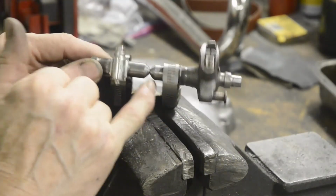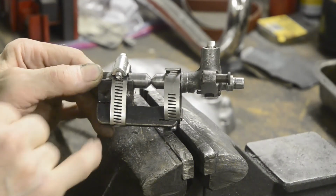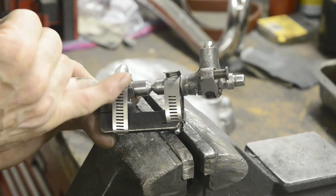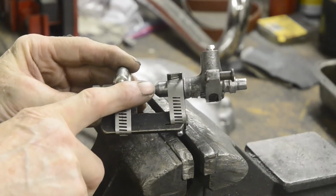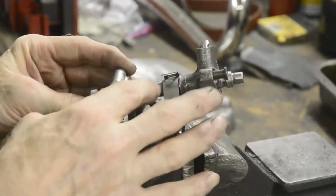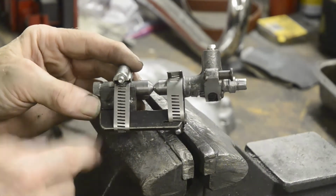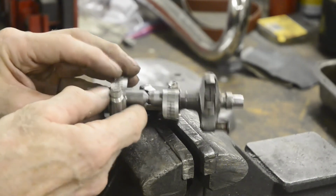Here it is with the two ends chamfered and fastened into the jig. You'll notice actually I didn't use the slot here because I remembered when I fastened it in that using the slot there tended to kick it up a little bit at the end, and they weren't exactly straight. So I put it right round the whole thing. There it's fine, it pulls it straight down into the shorter one, but here it was pulling it down. I couldn't understand why it didn't line up. And then I remembered that had happened, so I just moved the strap along. So now they're all nicely in line.